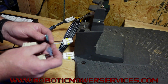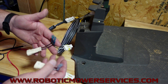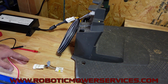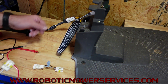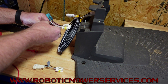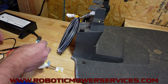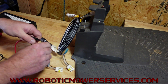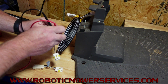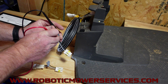What this does is make it easier to test for voltage while the system is in use. For example, we've got a 7-amp transformer here plugged into our low voltage cable. We'll unplug the low voltage cable, and we can test our transformer now without anything extra — no paper clips or anything like that. We can just stick the probes from our multimeter right in and test to see what voltage we've got coming out of the transformer.